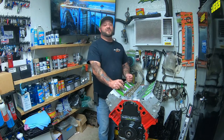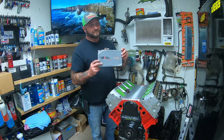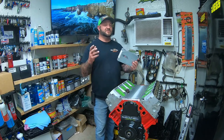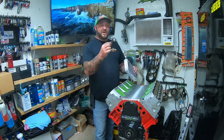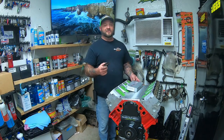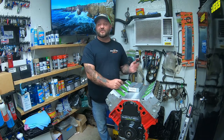So everybody highly recommends going with an aftermarket rocker, but there is a thing called a trunion kit. The one we're going to use is from Brian Tooley Racing — he's not sponsoring this channel, but I highly recommend this kit. I've used it three or four times, it's a phenomenal kit, and it's cheaper than a lot of the other guys without sacrificing quality. You're looking at a hundred to a hundred fifty dollars, and what it is is brand new guts to put inside your rockers. This will upgrade them to be every bit as good as roller rockers, instead of buying a four to eight hundred dollar set of roller rockers for an LS engine.